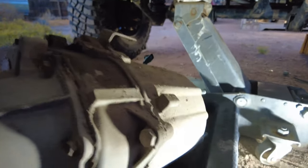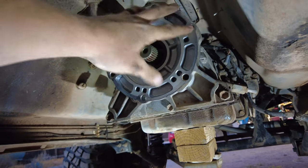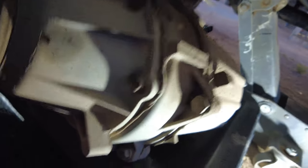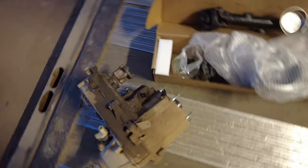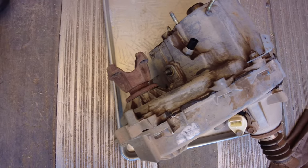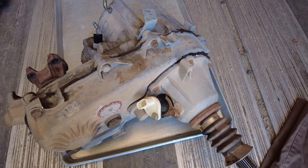I got the transfer case off of the transmission. It won't just fall onto you because the studs on the transfer case are holding it in the holes of the transmission and the output shaft is in the transfer case, so you don't have to worry about it falling once you remove the last bolt. It is out, resting there, and should be draining any residual ATF. Got the T-case removed and it is filthy, so before I fully get started I'm going to give this thing a bath in the morning, then split the case and get started on the slip yoke. After getting kicked out of my local car wash, the transfer case is now clean. Let's get started on removing the old tail housing and cracking the case apart.